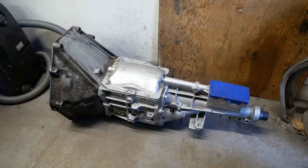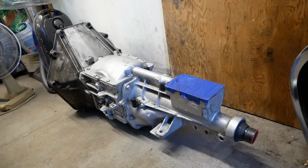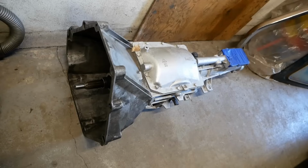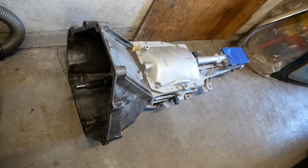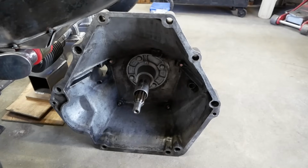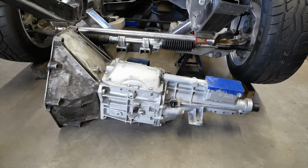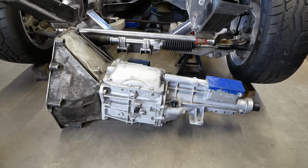On the transmission side of things, it's not exactly cut and dry either. Our Tremec T5 from a 2004 Mustang V6 is a great unit, but unfortunately it complicates life by having the longest input shaft of any other T5 ever made. So short of a custom spacer, swapping the input shaft over, or machining the one we've got, that's another factor we have to work around. As it turns out, we didn't like any of those options, so here's the first part of our solution.